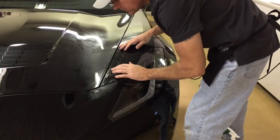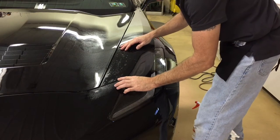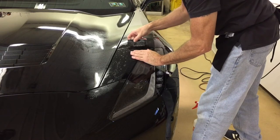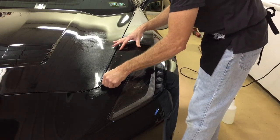The smaller pieces for the fender kit are a piece of cake — just spray your glide solution, float the film on top so you can adjust, perfectly align, tack one corner, and squeegee out the solution.